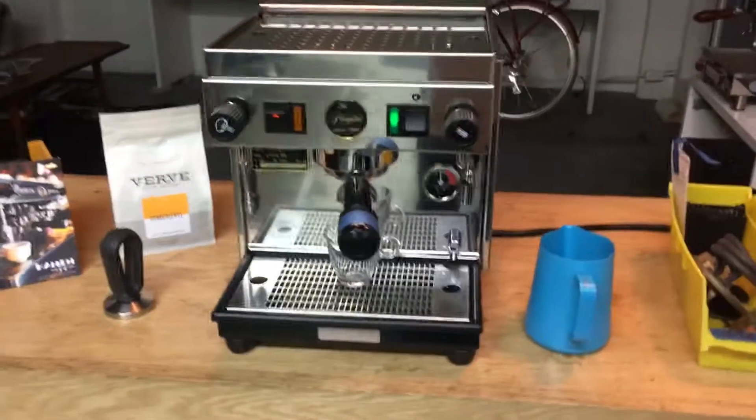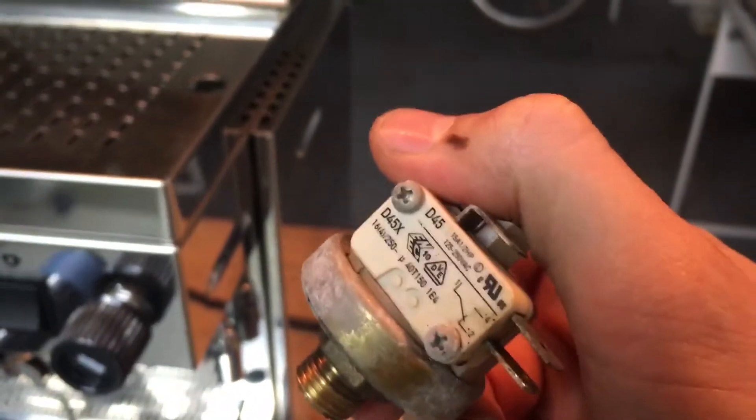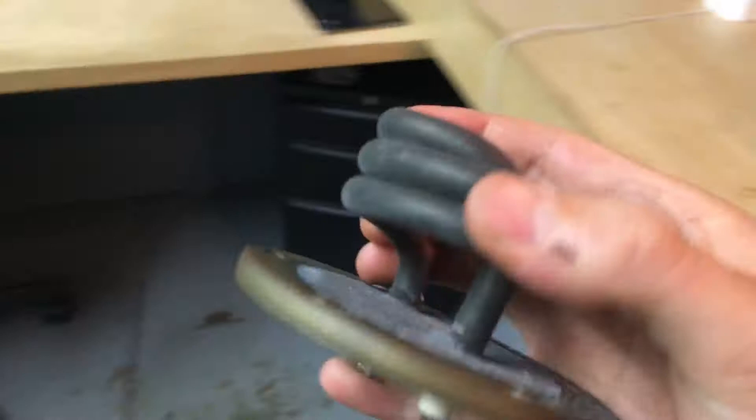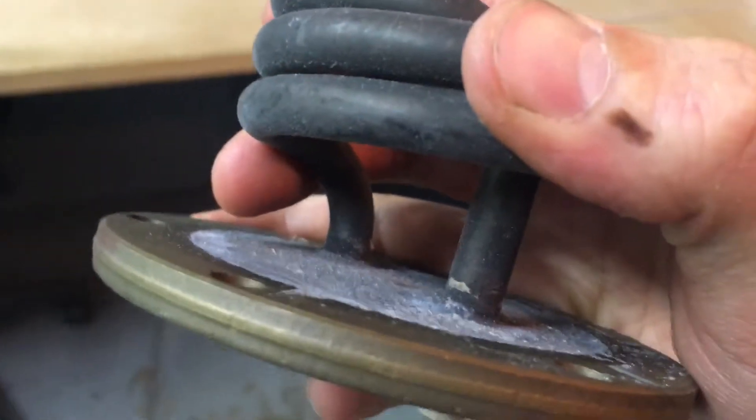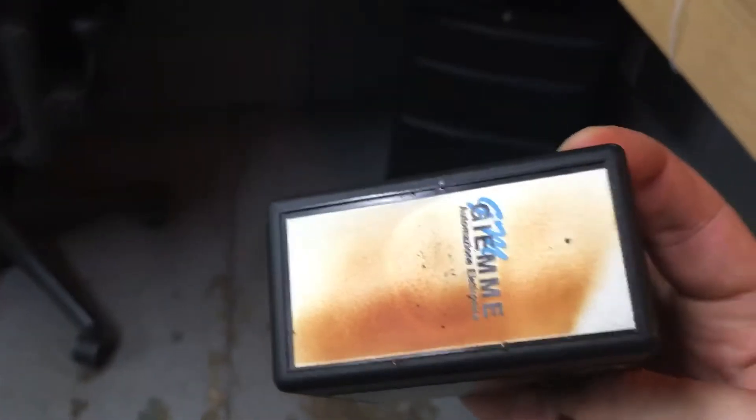So that's kind of what happened in this situation. Here you can see the pressure stat burnt, you can see the heating element where it's burst right there and the insides are shorting to the water. Here's the CPU and you can see how warm it's been on the top.